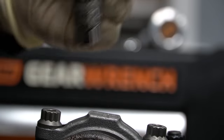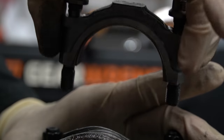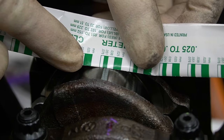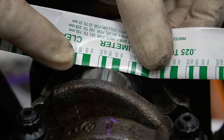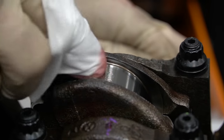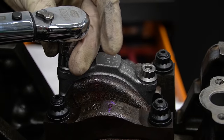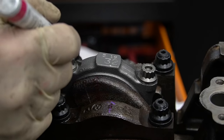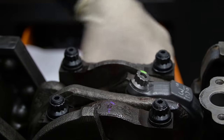Now pull the cap back off and check our oil clearances. The Plasti-Gage reads a little less than 0.038mm. Our oil clearance spec with the Plasti-Gage is 0.02 to 0.07mm with a wear limit of 0.1mm, so we're really good right in that space. Clean off the Plasti-Gage residue, put a little lubricant on the bearings, put it back together, and torque to 43 pound-feet doing 20 first then 43. Mark the bolts so we know they're torqued. I like to rotate the engine around after each cylinder just to make sure there's no binding, then position the next rod journal up and clean it while I'm there — less flipping the engine around.